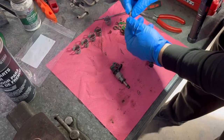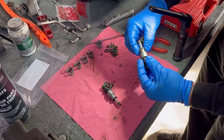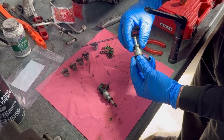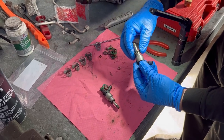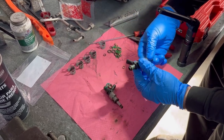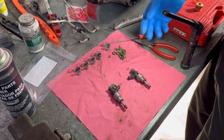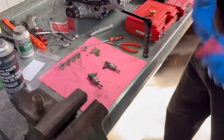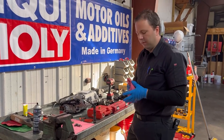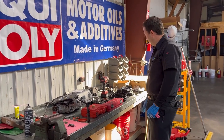These O-rings we replace on all of them. There's also another small spacer — I try not to mess with that one as it can be very fragile, though it is replaceable and usually special order. If you clean it carefully you can reuse it. We reseal all six injectors before they go back in so we don't have any drivability issues — those seals are so brittle and easily broken that we don't want to risk it after all this work.